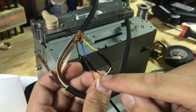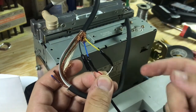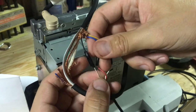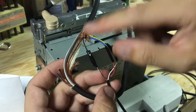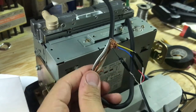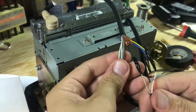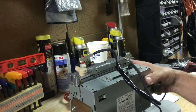Here I am soldered up. It just so happens that on my donor aux cable, the red cable is actually the left channel and the white cable is actually the right channel — which was unintuitive to me, but whatever. And here's my ground wired up to the ground. I'm going to throw some heat shrink down over this and electrical tape it all up and put it back together.